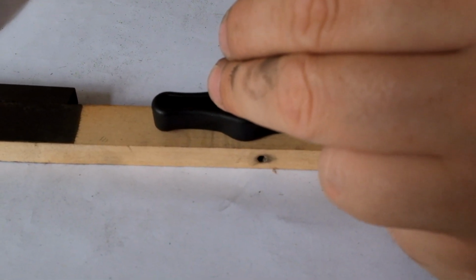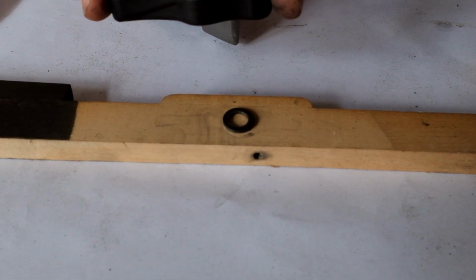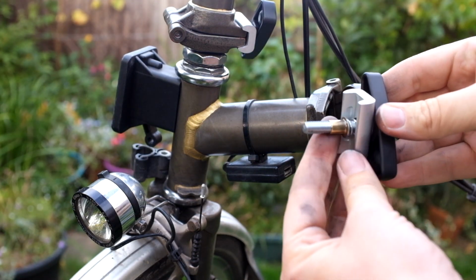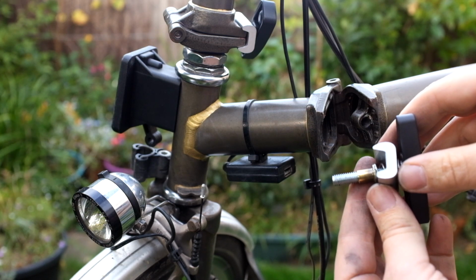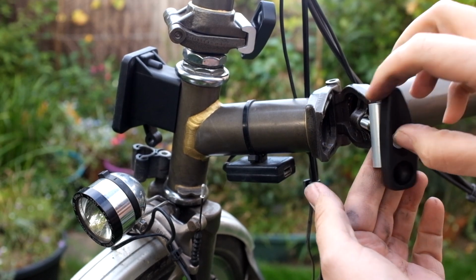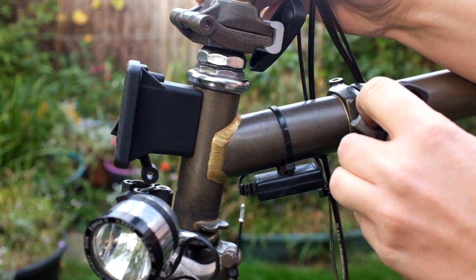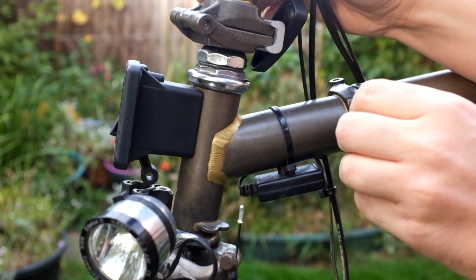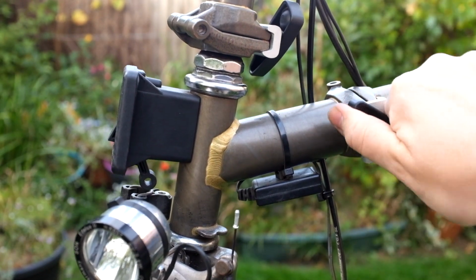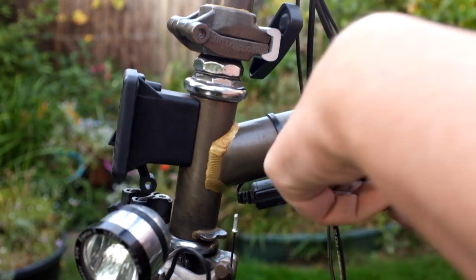I'm surprised the SpēdDial set didn't come with the washers, which would have made fitting a whole lot easier, so I'm not that impressed with that bit. Next, you place all of the parts onto the new bolt, with the exception of the locking nut, and screw it onto the bike. You tighten it firmly, which presses a small washer into place on the new handle.